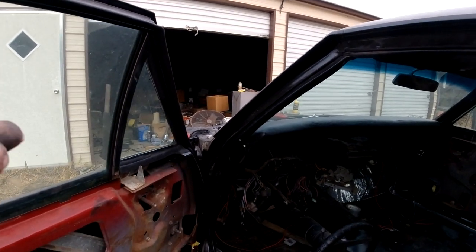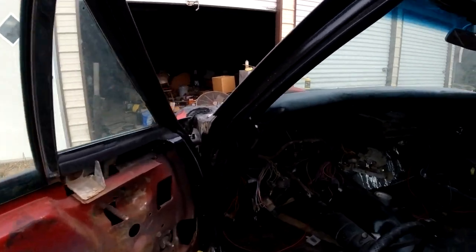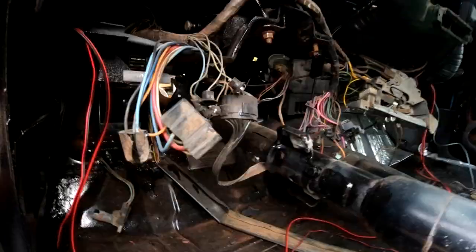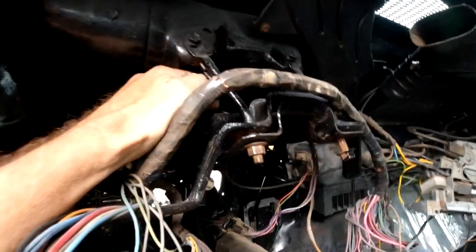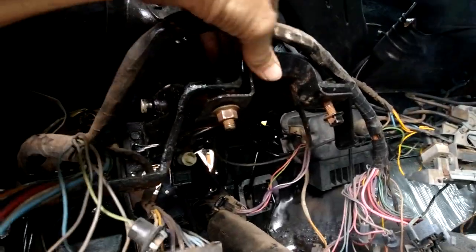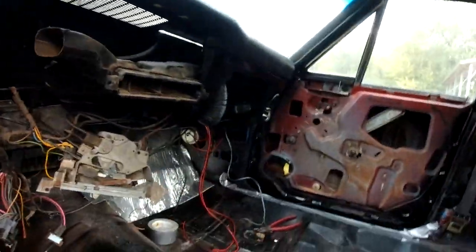Sure enough when I was showing it there were two holes - one upper, one lower. Although the instructions said it was an inch apart, it's more than an inch. This is the bracket here. I'm going to have to take it back out because it's got a pin in there with a cotter pin. I don't know how good you can see that - that's the top hole, that's what it's put in. I might be able to get that out without unbolting everything because it just screws in the back. Here's the bottom hole - I got to take that cotter pin off and move it down to this one, just so the rod is in the right direction.